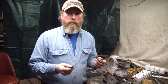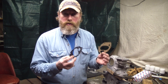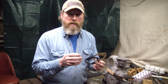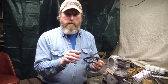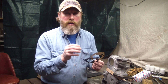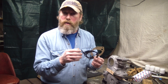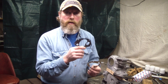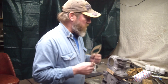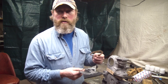If you had a shop that worked on American Motors all the time, they'd be privy to this. We measured the gaskets and they're different thicknesses. On a Harley, there are all different types of gaskets to change oil clearances on the pump. Some guys due to manufacturing tolerances have gears sticking out beyond the case and need a thicker gasket so they don't bind. Before you start sanding things for clearances, you might just be able to buy a thinner gasket and take care of the whole situation.